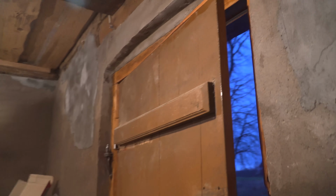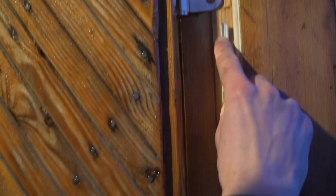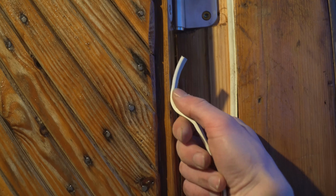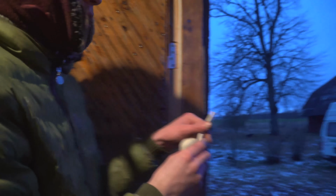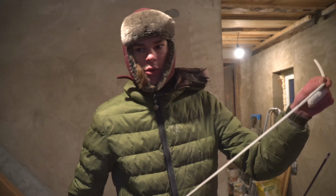So I finished the outside frame while I was doing the sandpapering. So we're done fully all around. But I was looking at the flat one we have on the door to go here. It seems a bit too flat, so I'm thinking to put it on the frame here somewhere, so it goes against this one and slides in, so it has double rubbers pretty much, because it's not fat enough to cover the distance. It would be better to put the same exact one on the outside here, and then they will probably squeeze through all the way. That seems like the better solution. That's what I found. So let me just do the door and then I can show you how it works. Hopefully it works.